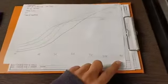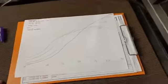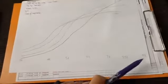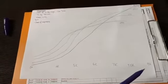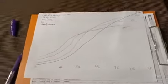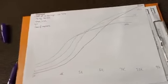Again, trying to run this on a stock engine with a stock bottom end, turning things to 9,000, it may not be very happy. So as you go bigger in the camshaft, your engine needs to be mechanically strong enough, and it needs to be built to take the additional revs that the bigger cam is going to give us. The other thing to consider with big camshafts in cars is the gearbox. Your input shaft may not like spinning at 9,000 RPM, and if your engine is, you go to grab gears and it might fight you. So you may need a more specialized box that doesn't mind spinning at those RPMs for crisp and nice gear shifts. So there are many considerations here.